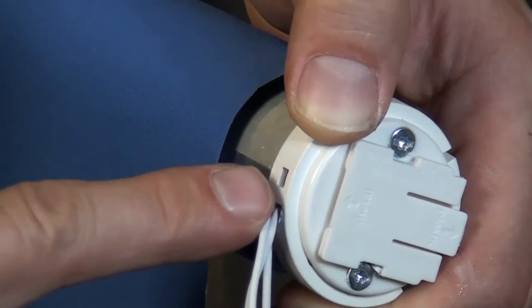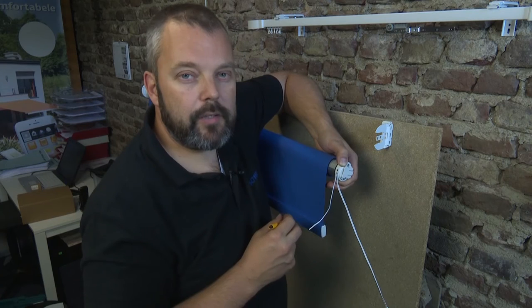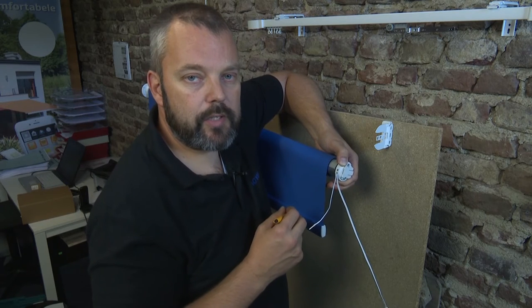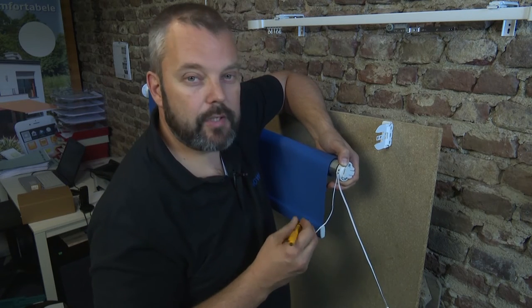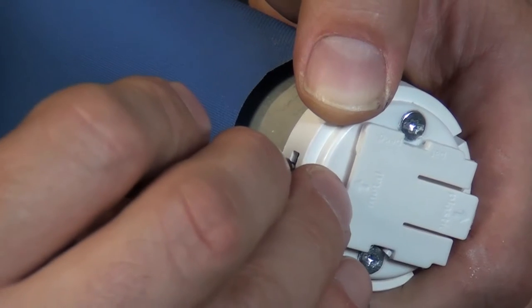You need to reset it by pressing this button here, which is located next to the wires. You need to press and hold it until the motor has moved up and down three times. You'll need a pen or something pointy, or you can reach the button directly.